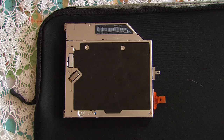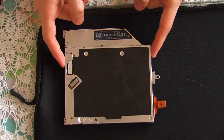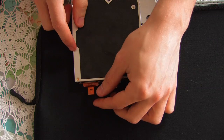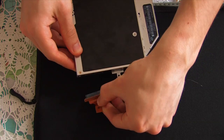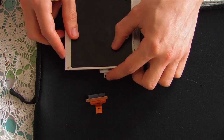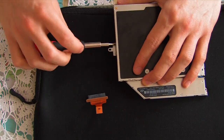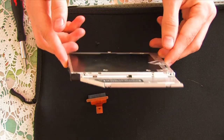Before you go ahead and install your new hard drive caddy, there are a couple of things you need to take from the SuperDrive. First off there is the SATA cable which connects the SuperDrive to your motherboard — carefully pry that off with your fingers. Secondly there's the support unit which connects it directly to the frame of the machine, requiring two Phillips screws. And that's it — your SuperDrive is decommissioned.